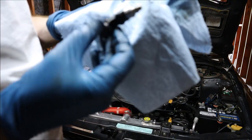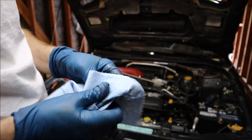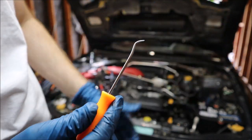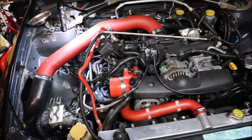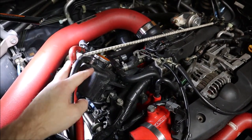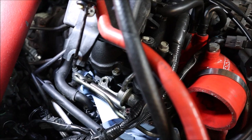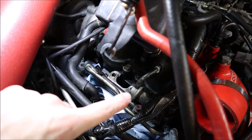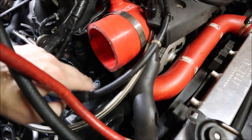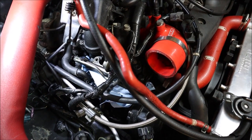Last one out — still had a missing gasket in there. The passenger side isn't that bad. Once you get the intake and the filter out of the way and loosen the expansion tank for the turbo — it's just on a couple bolts, bungee corded out of the way — you can see right down there. There are just two bolts holding the fuel rail in, and then there's one more bolt on the front that's kind of hard to see. Pretty easy to do. This side is a lot easier; there are just not as many wiring harnesses and plugs in the way. So pull the fuel rail and get the other two injectors installed.